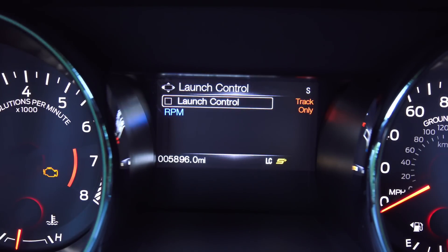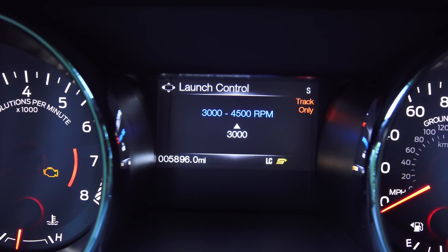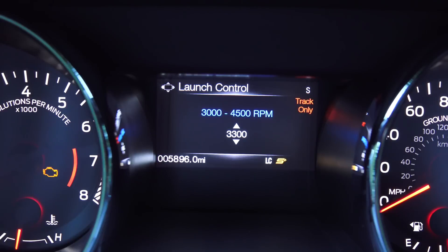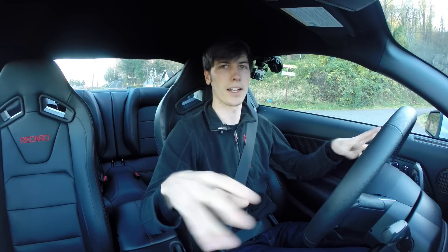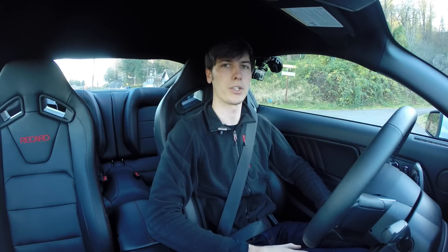Because it's on street tires and it's pretty cold outside, anything above 3,000 RPM it tends to just spin, and even at 3,000 RPM it has a hard enough time finding traction. So in these conditions I'm going to keep it set at 3,000 RPM, do a first gear launch, shift into 2nd, and let it do all the traction settings and sort everything out to get the optimum acceleration.